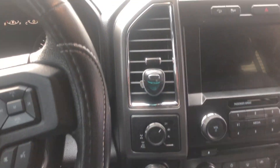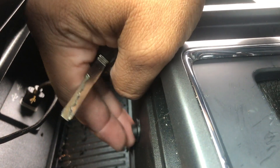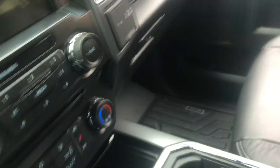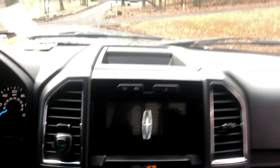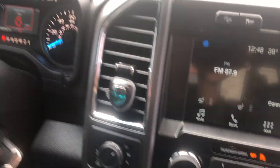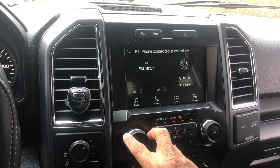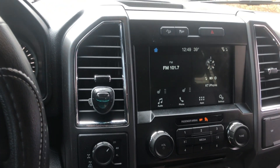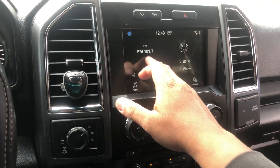Doors open, we'll go back here — DVD players are off. Back up here to the front, I installed my switch right here. I do have to clean up all the little shavings. You just reach down — on and off. Key started, lights back on, DVD players should be back on — yep, cutting on. But they're also able to be turned off with the switch, so everything is off with the switch right now. Radio works as normal — if I flip the switch it blocks all the audio so you can switch between radio and DVD audio.